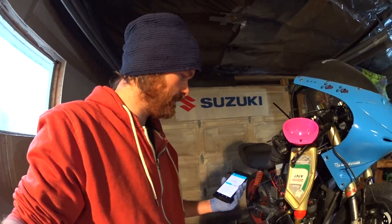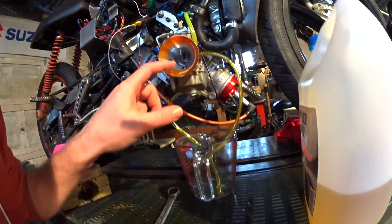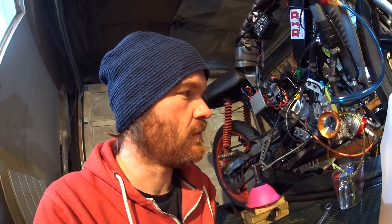I think that's sufficient for methanol and nitromethane. I think maybe 3.2 millimeters was actually a little bit too much on the float needle valve, because if I leave it sitting for a little while I can see that it overflows a little bit — so the valve isn't shutting off completely. This might be solved by adjusting the float level. I'll try that. Otherwise I may have kind of ruined my carb, but it will work when running — I just can't leave it sitting without shutting off the fuel valve.